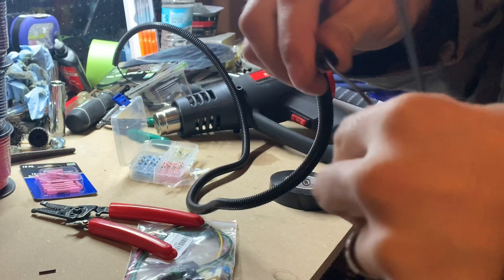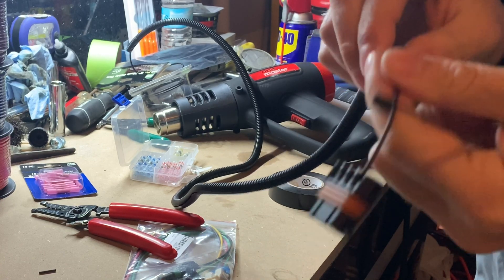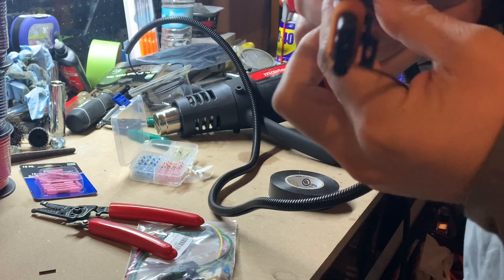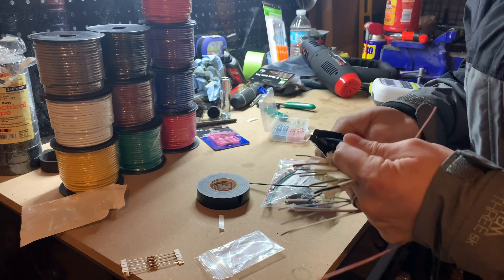The alternator's on with the resistor in here, and I'm going to tuck this over it so it's nice and protected. I'm going to zip tie this and then tape it — that way I have a nice strong hold there. This is the alternator wire, so we're going to strip this down and connect it at the harness for the alternator.